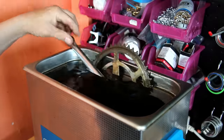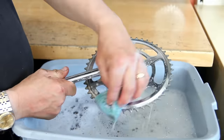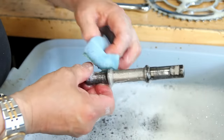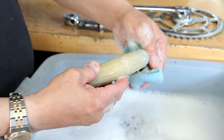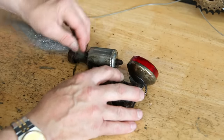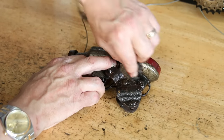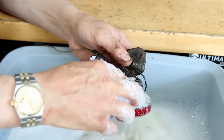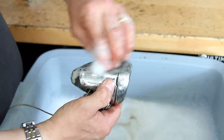I've put parts through the ultrasonic cleaner to get the grease really deeply cleaned before washing them down with degreaser — including the handlebar grips, which came up lovely. For the dynamo, I'm using a spray degreaser since we obviously can't put it through the ultrasonic cleaner. We give it a synthetic wash down with a bit more sympathy so we don't saturate the electronic components — and they work perfectly afterwards.